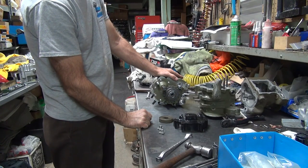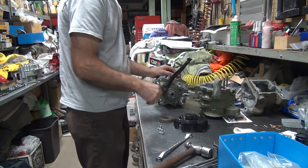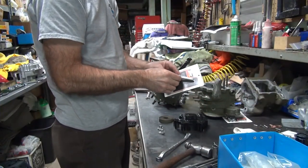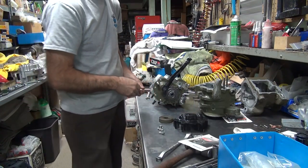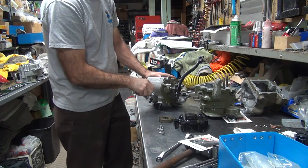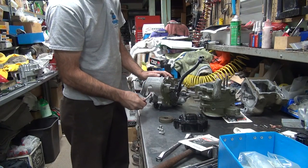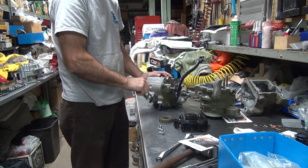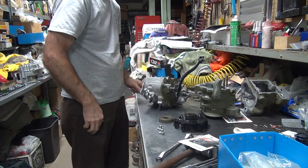So now I gotta work on the throw-out bearing. We had some kicker bolts too, I thought I got for you, didn't I? Got a kicker bolt under here? Transmission stuff. Now if I put that in there, you'll bend it. I won't. Unless you're wrestling around with it there. It's going to bounce around all over the place. Look at that. Just like it was made to fit. Always put grease on them. Right, because we don't want to pull the threads out of the aluminum. Nope. I bet that's been done before. No, so it doesn't rust as much. Oh.